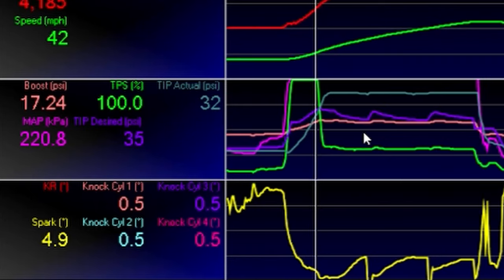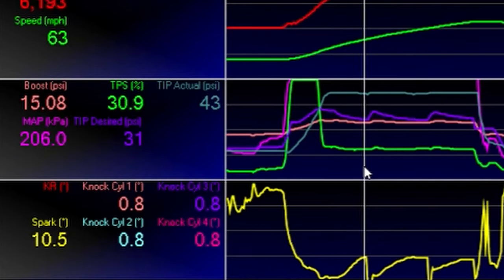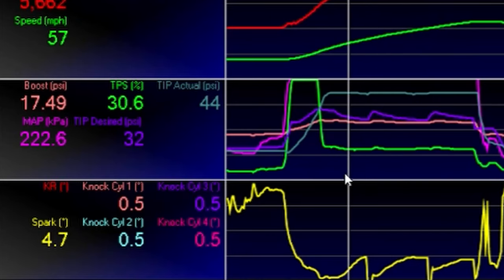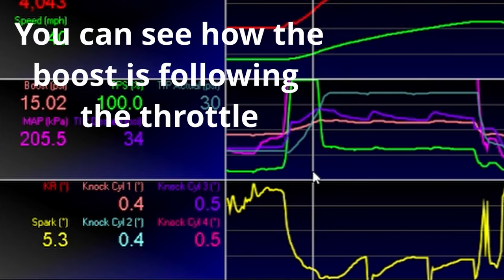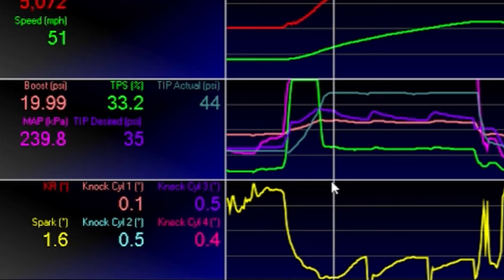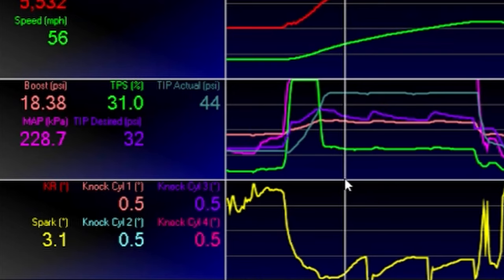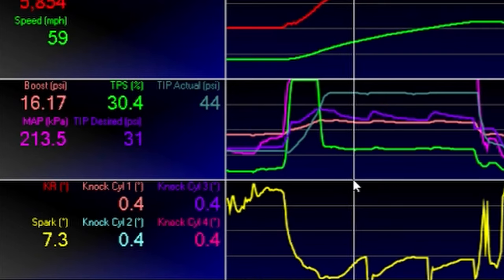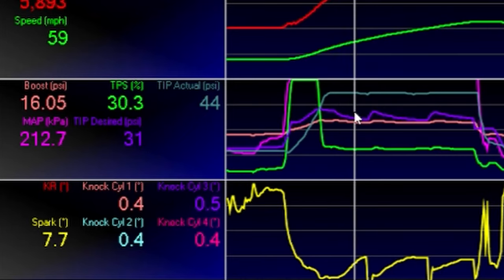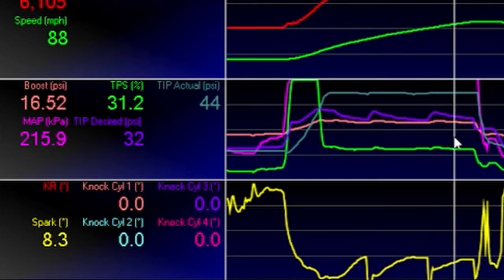If we zoom in a little bit, you can see that little pink line in the middle — look how flat that is. That is our boost. Because it hit some limits it pulled back slightly, but it's pretty flat, no big spike, pretty linear on tip-in. It hits right there and levels out, holding around 20 PSI — 18-17 as it starts dropping. That number would likely be higher if my OAR was where it's supposed to be, currently only at 0.25, not even at 1.